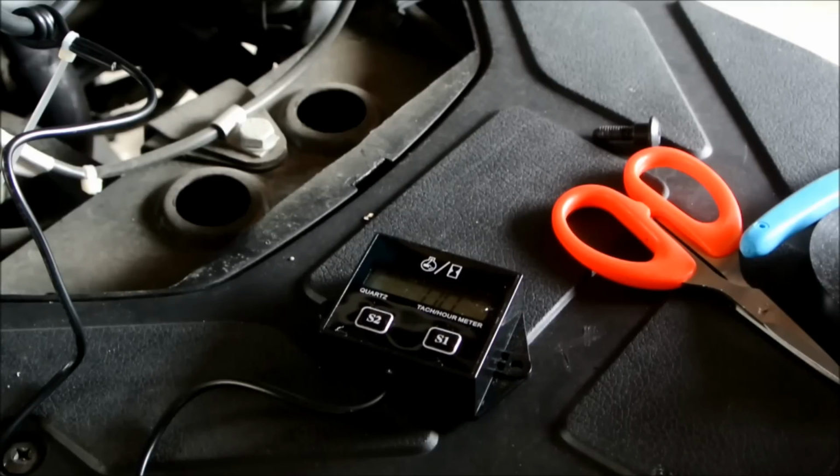You should see something reasonable. You shouldn't be seeing 10,000 RPM at idle, for example. That makes no sense at all. Usually these 50cc bikes will idle at around 2000 RPM, so that would be a good baseline to check if you've set the correct setting.